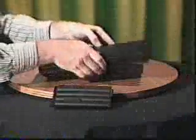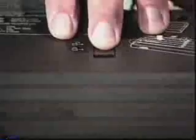To insert the battery, remove any wrapping and then turn the ThinkPad upside down. Release the battery lock by pressing it back. Insert the battery with the label facing down. Now secure the battery lock by pushing it forward.